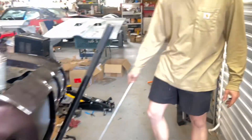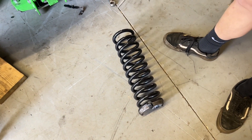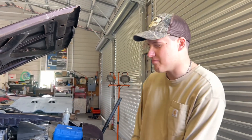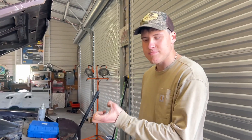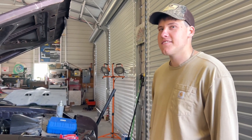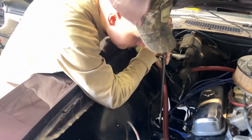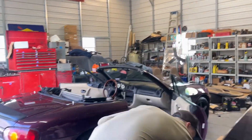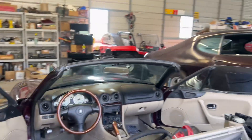What was he actually working on? You got a new rotor on there. This is the coilover strut spring - they're two piece and they've killed some people apparently when they go to put them back in, because you have to jack up the bottom and it compresses the spring, and if it slips out it shoots out and it'll take your head off. So he uses this chain and puts it down through the control arm so it holds the spring. If the spring shoots out it's gonna hit this and break that chain around it - that way it doesn't take your head off. He said it shot out on him. That's your fun facts for GTOs for the day.